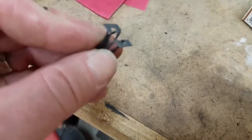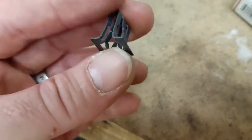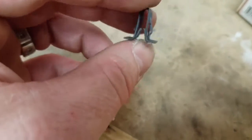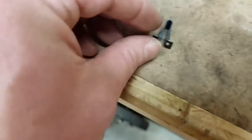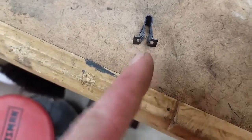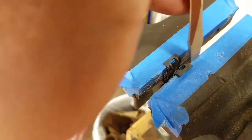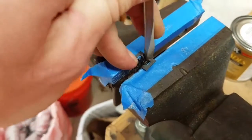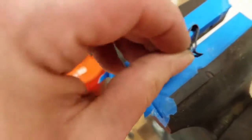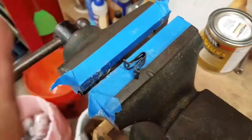These little clips hold the vanity light up into place in the headliner. Problem is when you pull that out, those four little fingers grab into the plastic and get pulled out of position — they lay parallel across this, and then you cannot reinstall your clip because of their positioning. So what you do is put it in a vice and take a screwdriver. When those little pieces are laid across there, you push the screwdriver around there, hit it with a hammer, and get those driven back down. That's the same principle that traps the plastic. Now those teeth are repositioned — reinstall that in the holder up in the roof, and the vanity light just clips right into place and helps hold the headliner up tight in the front.